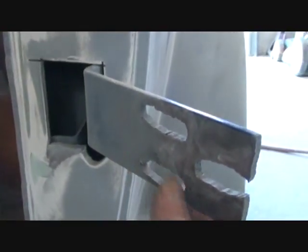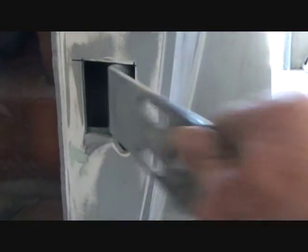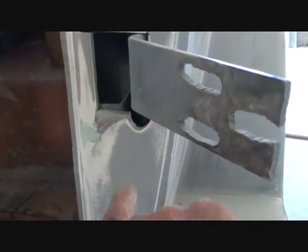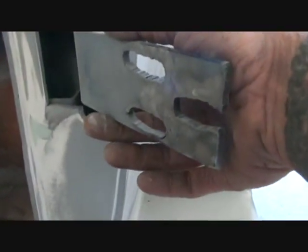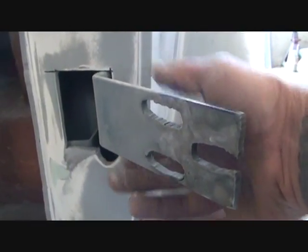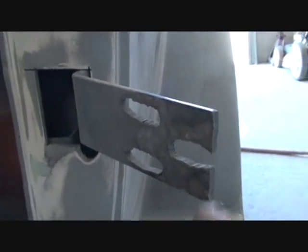Once you run your wires up here, the wires are going to feed across the bottom of your hinge here and then go into your door. What that's going to do is give it a nice pocket here, and you won't have to worry about drilling holes anywhere because you've got your hinge post in the way. And when you get your interior put in your car, what you'll do is take your wires and run them across the bottom of the hinge and they will fit in the pocket on the door there.